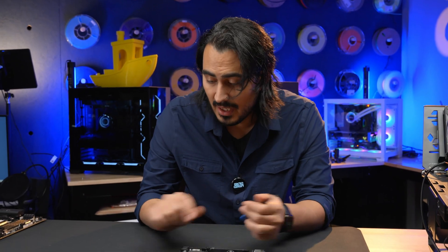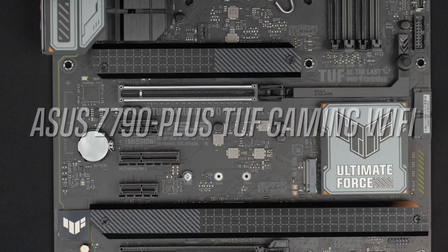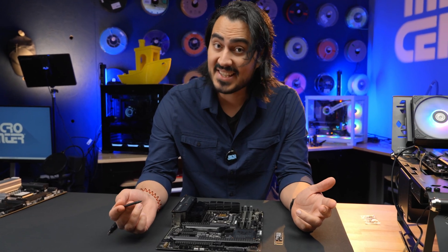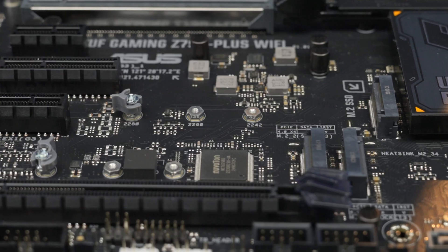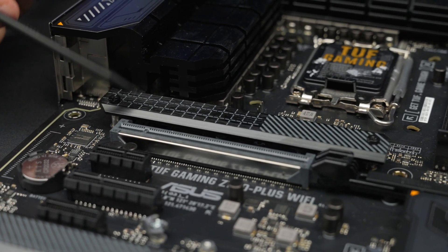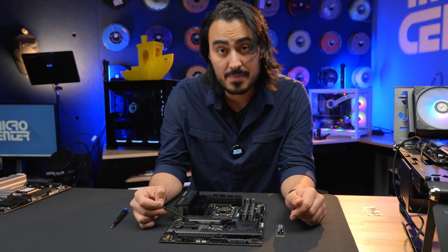And that's it — pretty easy. That's how you do it on this board when the slot is fully exposed. Now let's look at another motherboard. On this board we have an exposed M.2 slot here, so you might think that's where we're going to put our drive — but actually it's not. Boards like this have a bunch of different M.2 slots, and you want to install the main drive under this heat sink, because the main drive always goes between the CPU and the first PCIe connector.